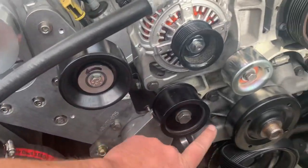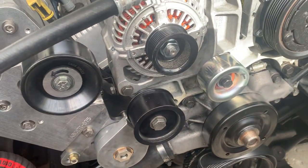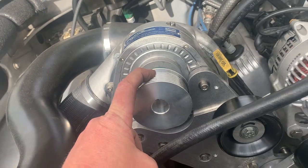For tensioning mods, try to keep the belt runs as short as possible — like from here to the crank, keep that short. If I have belt slip issues later, I can do a couple more things. I sandblasted the crank pulley down below and sandblasted this pulley up here.